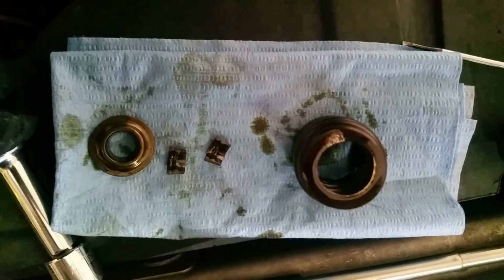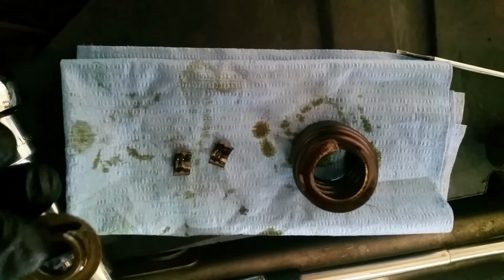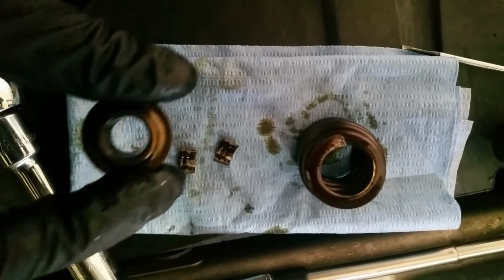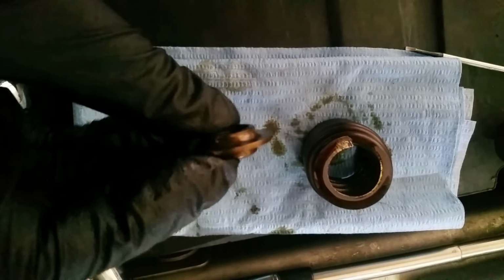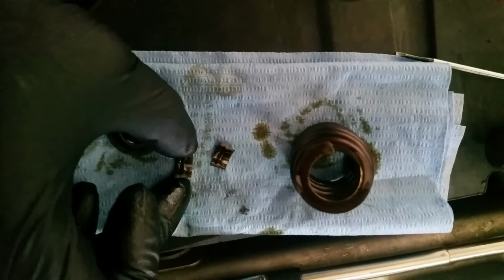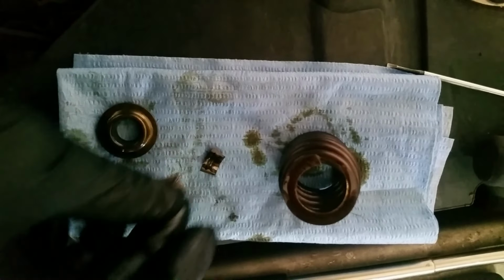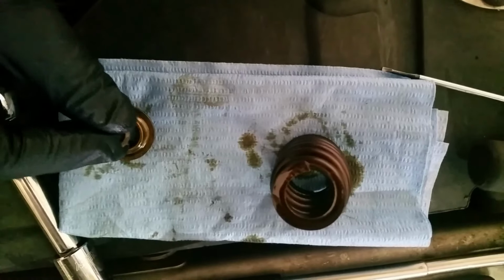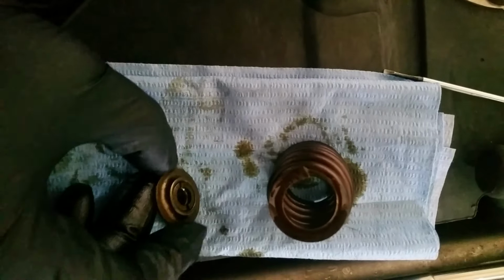I'm gonna try and show you guys what's going on here with these valve springs. If you've never seen them before, they're not entirely intuitive. So what you got is the cap, and it's really hard to tell on camera, but the inside of it, that inner hole, is actually tapered. And what that allows for is the slight taper on these locks. They're not perfectly cylindrical, so there's the top side, and there's the bottom side. You can see it's slightly thinner. So that means they're angled, and so what happens is they sit in here at an angle like that. And I'll take them back out here.